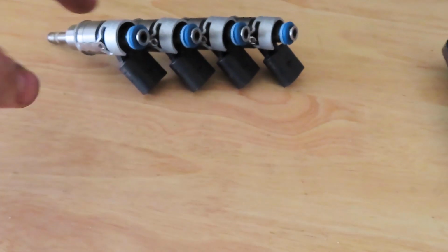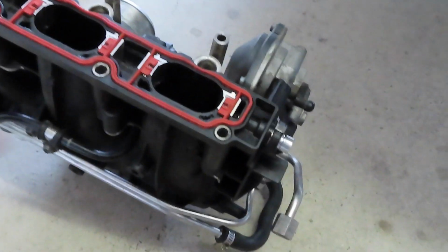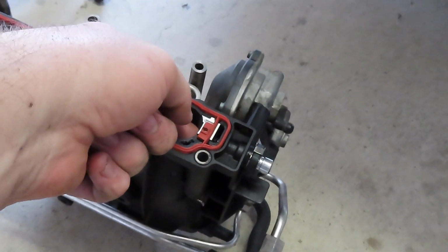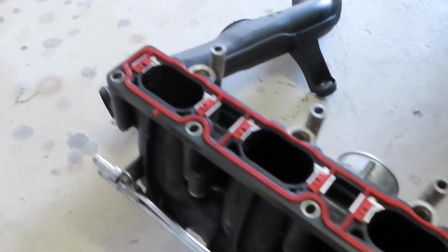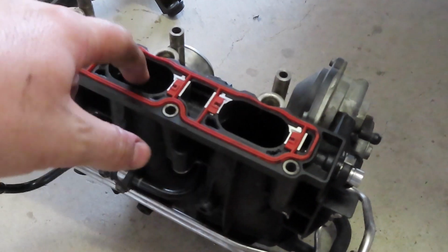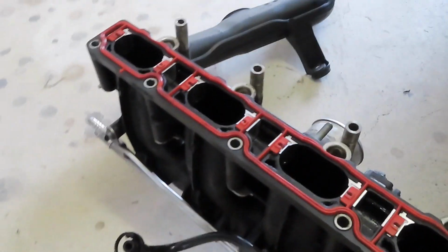Boosh, boys! Well, it's been probably half a day since I last recorded, actually. But we're essentially halfway through the runner flap delete. So new injector seals, all on there, nice and easy. The manifold is done, with these little billet things, I guess you could say. They're the replacements, so there's no flappy things in here now, which looks pretty good.